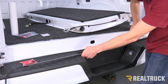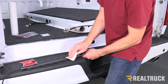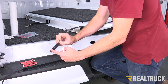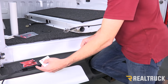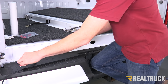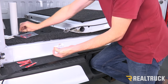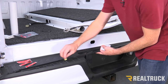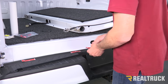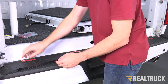We're going to clean off the surface of the bed of the truck where the light bar is going to attach with at least 90% isopropyl rubbing alcohol. We're also going to clean off the back of the plastic on the light bar with isopropyl alcohol. Now we're going to apply some adhesive promoter. If we were going to be using the standoffs, we'd apply the adhesive promoter to the back of the standoff, but we're not using standoffs, so we apply the adhesive promoter to the back of the light bar itself. Do not use adhesive promoter on a painted surface — the 3M tape is designed to stick to the painted surface; when you go to plastic is when you use adhesive promoter. Open up the bag, you can use gloves if you'd like, and let that dry. Now we're going to place the 3M tape on the back of the light bar, evenly spaced to get good adhesion, and make sure we place the light bar with the 3M tape on the spot where it's going to have a good bond.